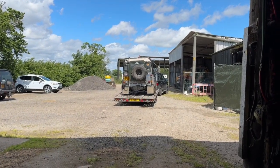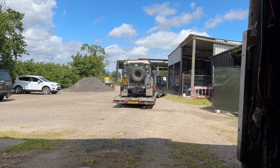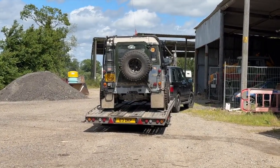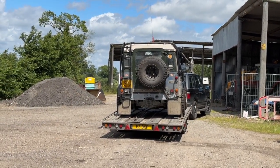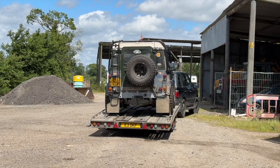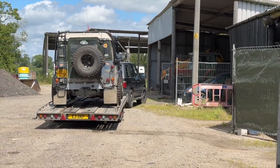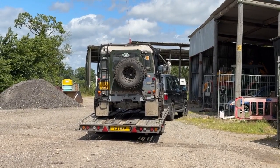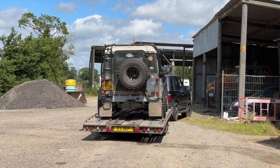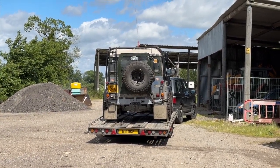We have returned from the MOT. It didn't even go in the MOT. Got there, got it off the trailer — no brakes. It's popped a front flexi hose, which are braided Goodridge ones. I think as opposed to popping it, I think where it's aired out it's got caught and crushed it and split it. So that's a good job I didn't drive it.